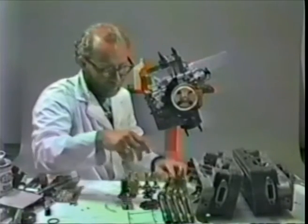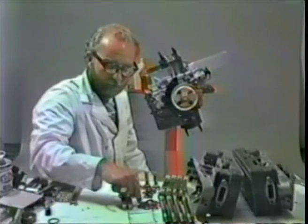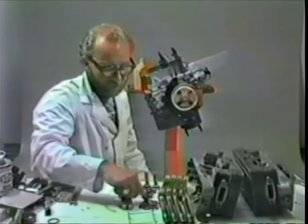What we'll do now, we get out 16 seals, the red ones are the best. These are the seals for the pushrod tubes, little trapezoidal type seals. I like the red ones the best, the green ones second best, and the black ones the least, but the black ones work fine too. We get out 8 head bolt or head nut O-ring seals here.